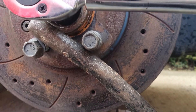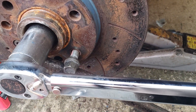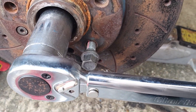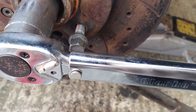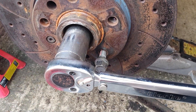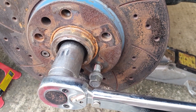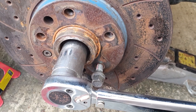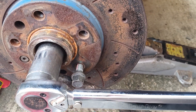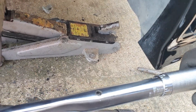That seemed to work easier than I thought. You can see what I've done — a couple of wheel bolts in, an old jack handle just there, torque wrench on there. I did it up with the impact wrench initially and that wasn't far off. That's done up to 130 newton meters, so now we've got to loosen it off, then tighten it to 20 newton meters — I think I'm going to have to change torque wrenches for that because I don't think this one goes down low enough.